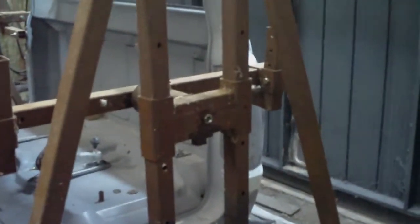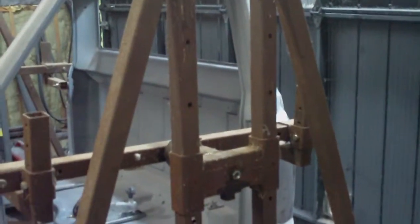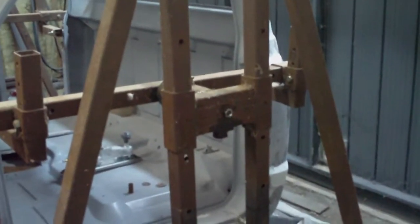This design is not a good design. I like the bracers going from the bottom corner to the top corner on either side, but originally I did this dual slider approach so that I could put a jack up underneath it to lift it up — but that was a bad idea. It was really finicky to get aligned right when welding, and even the slightest amount of warpage caused it to bind. Now what I did to counteract that — you probably can't see it because this thing is filthy, it was sitting in the barn — I ran some welds across the top to pull it so that it would bow.